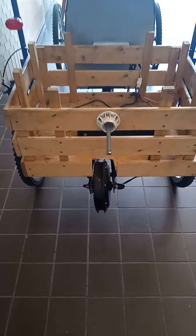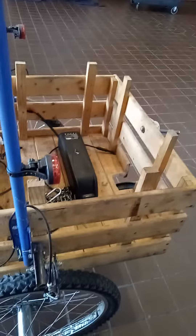I put the sprocket on that side with a chain. On the axle — you might not be able to see it — I took a sprocket from a 20-inch bike, cut it because I couldn't get the axle apart, bent it around the axle, bent it back, and welded it on. It came out great. It does about 15 miles an hour with a 48-volt, 750-watt motor.